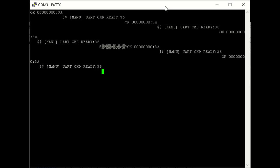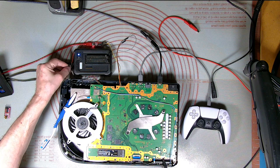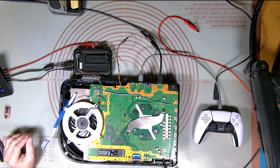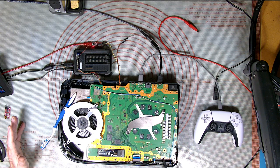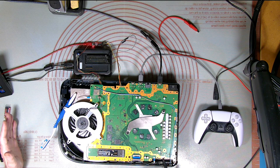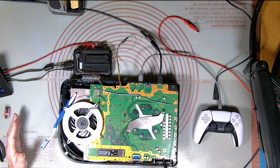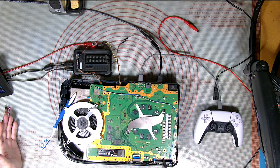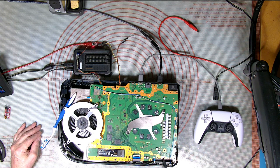Now I'm going to upset it completely by loading in a three-beep code. There are quite a few people using the T-56 programmer doing exactly this, and I've had no end of people say they get problems where the programmer keeps coming up with loads of errors. A lot of the problems are because the flash is still on the board — when you put power onto your programmer it's going to try to power the board. It hasn't got enough power to do that, so it could destroy your programmer, and if it does supply enough power it can bring the Southbridge to life which stops it from working.